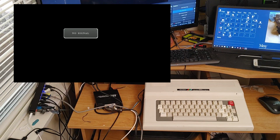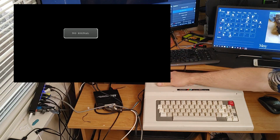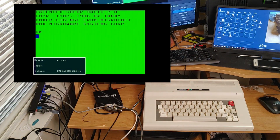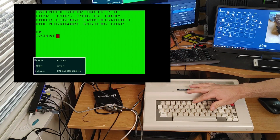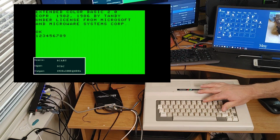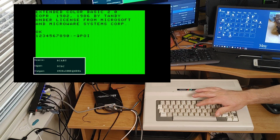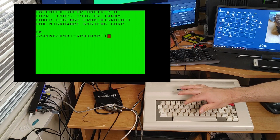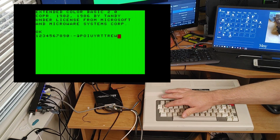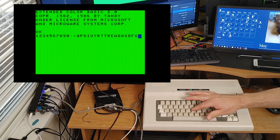However, before we get ahead of ourselves, one of the things that we do have to do is test out that the keyboard is working. So I've got it hooked up here. And it's simply hitting each button to see if they all work. Now, if you're finding that the buttons are a little hard to press or they double press or anything like that, then the thing to do is to go underneath the board and either tighten or loosen the screws around where that key is.